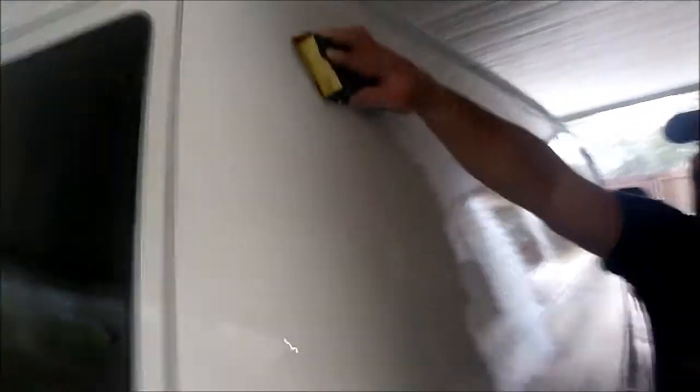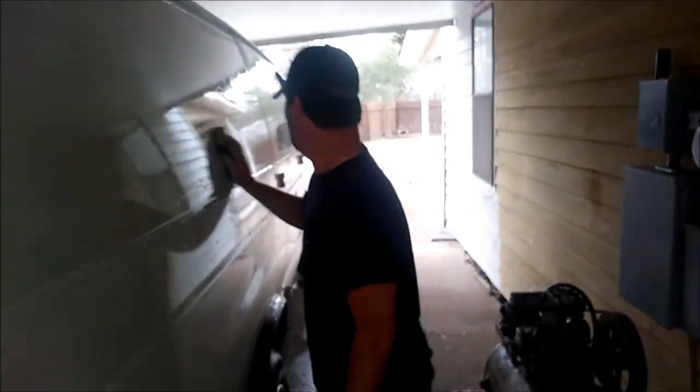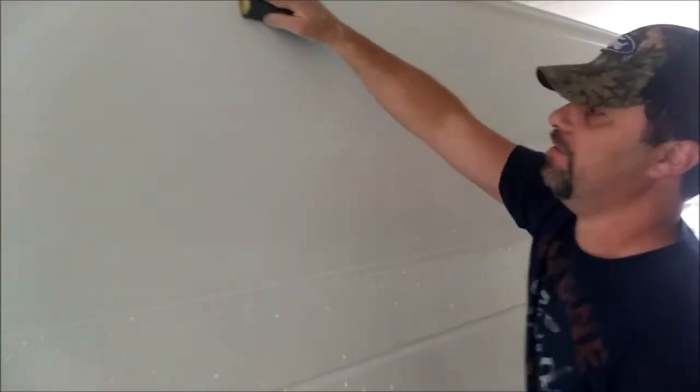I went back and forth with a 50% overlap. Despite how many videos I've watched on how to do this professionally, at least the paint went on even. I couldn't avoid the orange peel — maybe it's because I didn't have enough air pressure in my compressor, maybe too much. Some people say it was air volume not coming out fast enough. All I know is the paint is on there and now I need to fix it. We're doing this one panel right here. We're going to wipe this down and try the 3M three-stage kit — compound, fine compound, and ultra fine. I forgot what the kit's called but it's been out for years and everyone loves it. I haven't really compounded a vehicle before — I've only hand waxed.